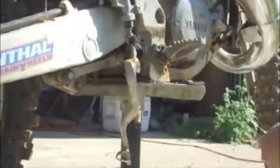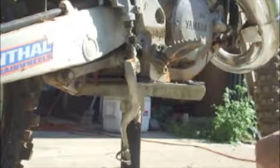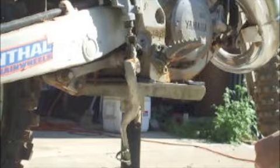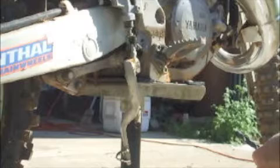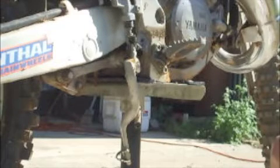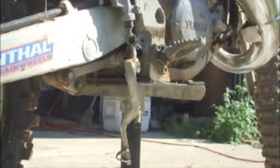Let's see if I can do this without tearing anything up. The tap is an M12-1.75, and the internal threads are M8-1.25. So if anybody else has got to fix this on their bike, those are the components that you will need.